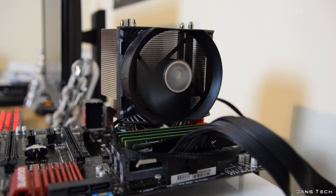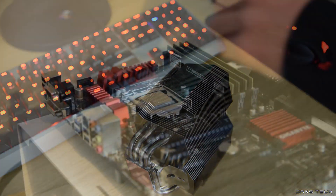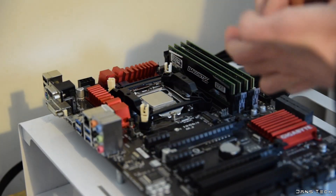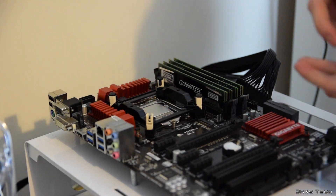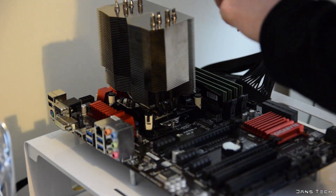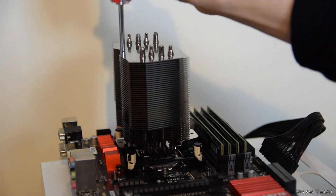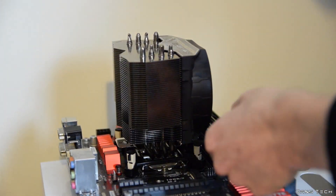The included fan is a 92-millimeter PWM fan with a rotation range of 600 to 2,000 RPM and simply presses onto the heatsink — you'll need a flat-head screwdriver to remove it. Installation of the Freezer 13 is very easy with a pushpin design; no backplate is needed given how light it is. Remove your old heatsink, place the mounting plate over the CPU socket holes, insert the four pushpins, add the second half of the pushpins, apply a small line of thermal compound, place the cooler on top, screw down the two 12mm screws evenly, clip on the fan, and connect the fan header to your motherboard.